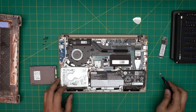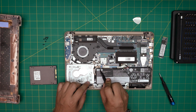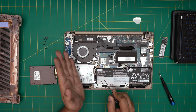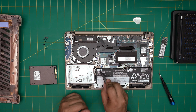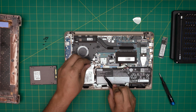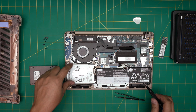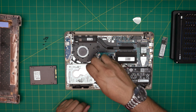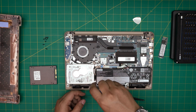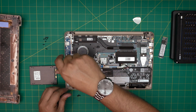To remove the hard drive side, grab a tweezer and open up the latch for the flex cable connector — flip it up 90 degrees, then grab the flex cable and slide it out. Next, remove the four screws holding the caddy that holds the hard drive — one, two, three, four. The screws are all the same size and height, so no need to worry about mismatching.